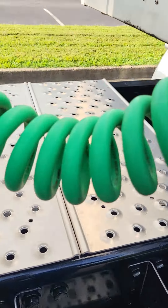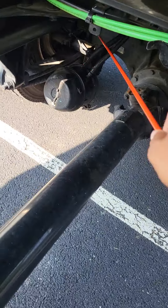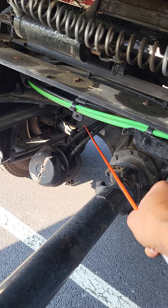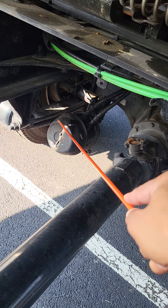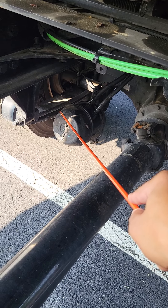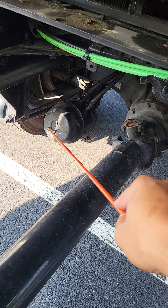So now we're going to go inside here. You're going to see me touching the brake hose. The brake hose is not cut, frayed, dry-rotted, or bulging — I hear and see no leaks. That runs straight down to the brake chamber and locking ring. The brake chamber and locking ring is not bent, broken, or cracked — not missing any nuts, bolts, or screws — and I hear and see no leaks.